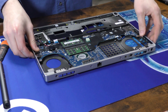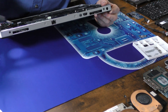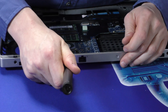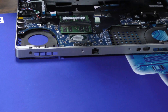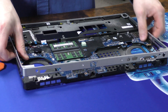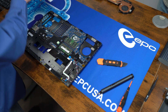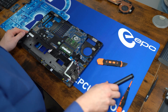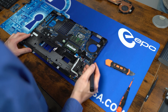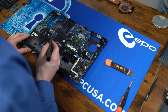We have seven of these screws around the edge of the case that need to be removed. Once done correctly, the aluminum edge of the case itself should just pull away. There are also these two screws in the rear. After all that, we're finally able to get out the board itself, which is only held in by three of these small screws, all of which have an arrow pointing to them.